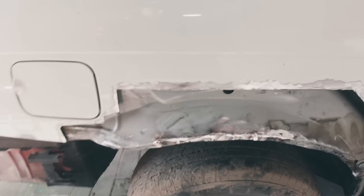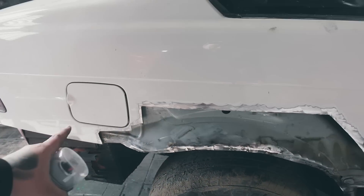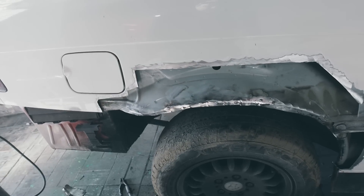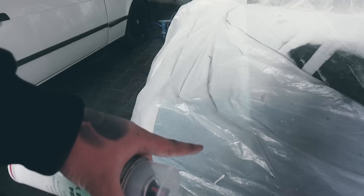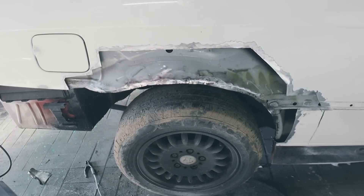Now the next step is to grind everything down and remove all the cavity wax. After that we spray everything with this Car Systems epoxy primer. It's 1K. The cool thing about it is you can weld through it. We'll spray everything here with it — from inside, outside, and also the sheet metal. We weld through it and the stuff turns liquid and runs into all the cracks and grooves wherever it goes. And of course at the end, when the side is painted, we'll also do a cavity wax seal. This is what I've had the most experience with. Thomas also used it when we welded the Skyline. I trust it. There are probably other products out there but I think for hobby use it's enough. Let's go and prepare the wheel arch for welding.